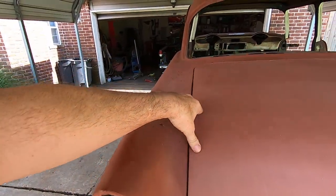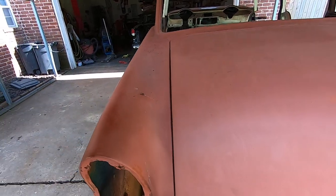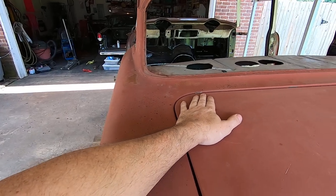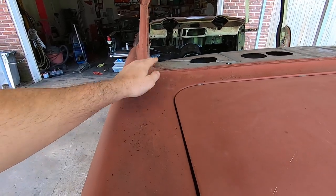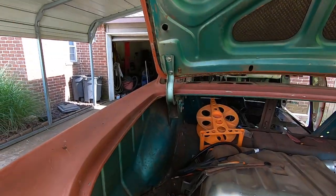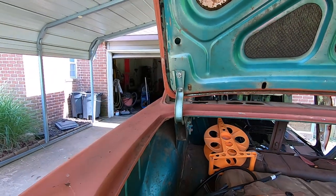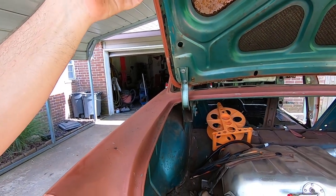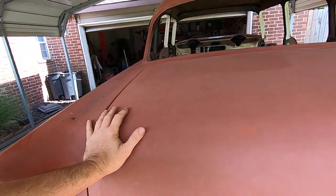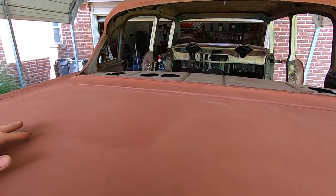These decklids are always a mess — they stick up past the body, sometimes they're down in, and they're not up where they need to be to meet the quarter panel. That's pretty much an easy fix: you can do that with shims behind the hinge and the deck lid — maybe one shim would fix it instead of doing two, but you've got to kind of mess with it. Now this will be the third time I've had to do this to a tri-five deck lid.